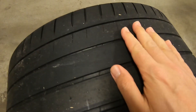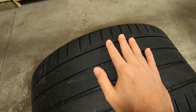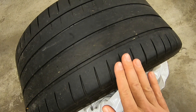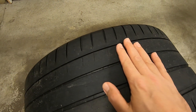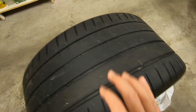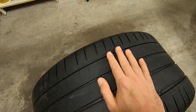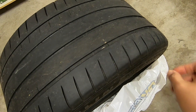Now, if we take a really close look at this, you can tell I do a lot of straight line driving because the inside is worn out more than the outside. That's not because they're inflated weird or anything like that. It's just, of course, if you're taking your car on a track with a lot of hard cornering, you're going to eat up the outside of your tires a lot more than the inside. And you can see there is a lot of tread left on the outsides — that is just normal driving on the street. Of course you're turning corners, zigzagging, windy roads, that kind of stuff. It's not going to eat it up right away. But I've heard on the track, the Cup 2s especially, they're a lot softer than this, and you can almost eat up a new set every time you go to the track. So unless you've got deep pockets, you might want to be looking for an alternative if you're going to be doing that kind of stuff.